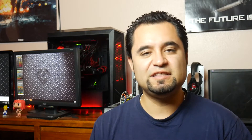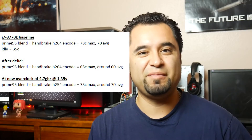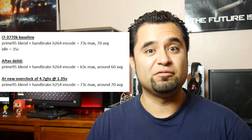So we're back — it's the next day, I shaved, got it all cleaned up as you can see. The de-lidding was a great success. At stock settings, the same exact way that I took it out I put it back in, and obviously de-lidded it after that. I ran my torture test on it, which is Prime 95 blend with the Handbrake H.264 encode, both at the same time. I got a 10 to 11°C improvement — it dropped by 10 to 11 degrees Celsius. This is going to be more significant if you're doing something less demanding on the CPU like gaming, but it would still heat it up plenty. I think that's a great result.